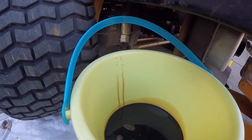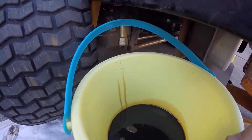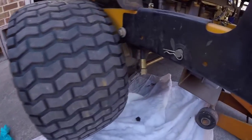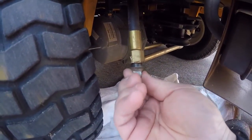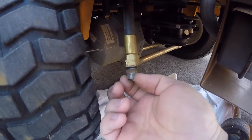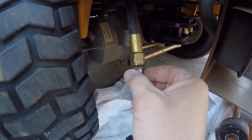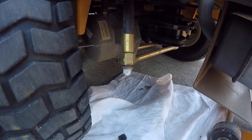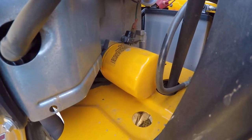It's been about five minutes and you can see a little bit of oil is still dripping out. I'm going to remove my bucket of oil and replace the plug back into the drain hose. Remember, it's standard thread — righty-tighty, lefty-loosey. I'm going to finger tighten it first, and then I'll take my channel locks and make sure it's good and snug so that we don't have any oil leaks when we start refilling our mower with oil.